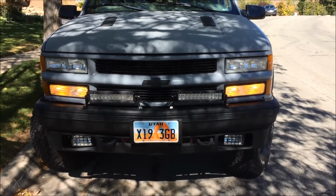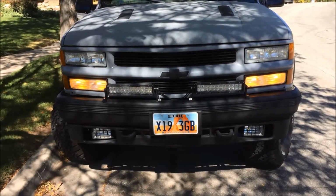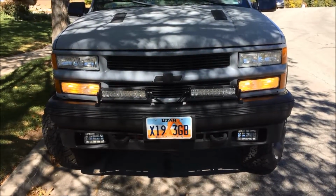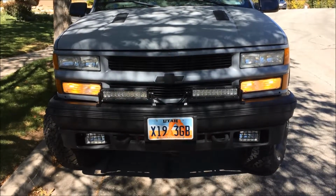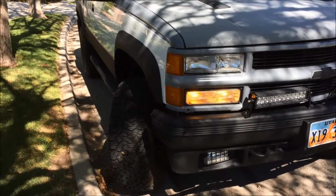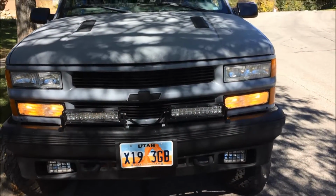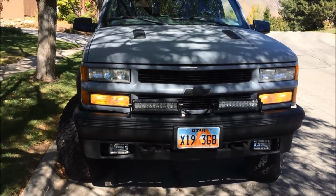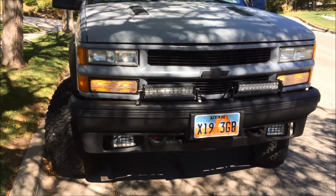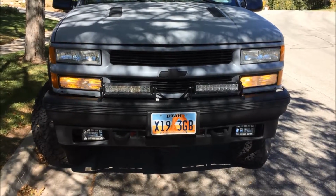So this whole adventure has ended in partial failure. So trying to see if you can take the poor man's route and just use LED bulbs to replace your bulbs and see what happens. Well, yeah, you look at the comparison now, this is definitely brighter in the daytime, but because of the vagaries of electronics, side markers don't come on when you're just in marker mode. So watch this. Notice when in flasher mode, the side markers are flashing like they're supposed to. So they'll work for turn signals, but not really for markers. That's as good as the front gets if you're just using these LED bulbs.